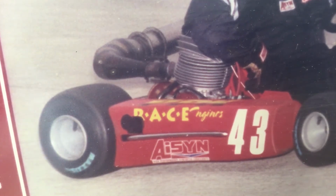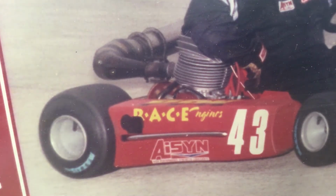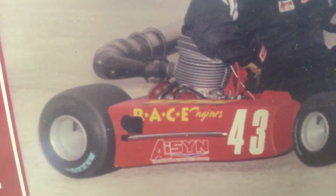So what we try to do when we go to a track is look at your longest straightaway. In the bashers, they would look at how far they want to run that car and then let off of it. You've got to be realistic, guys. So we put the biggest sprocket on that we have that they offer for karting, because you see how big it is. It would rub the ground, kind of like it would rub the chassis on an RC car. Same problem. The biggest one is going to give you torque, it's going to give you low end. It's easier for that motor to leave because it's bigger, like on a bike. We talked about that the other day. The bigger that is, the easier it is for that motor to leave.